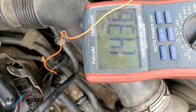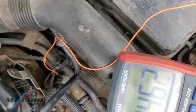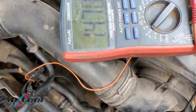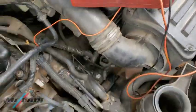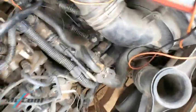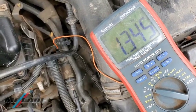Now if I start this engine, let's experiment and see if this resistance reading is going to change. Let's see if the resistance starts dropping. That's interesting — the fan just kicked on in full duty cycle because I removed the temperature sensor. So that's another way to test it. It was reading 1.4 kilohms before and it's now decreasing — you can see it right there, it's decreasing.